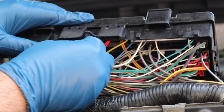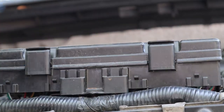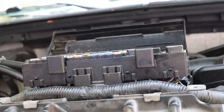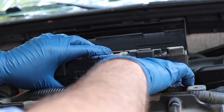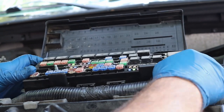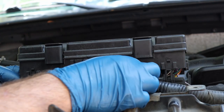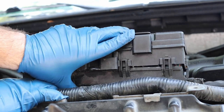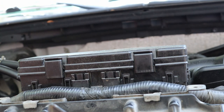Stick this right into there — it clicks right in. Tuck the wire in. Looking at the top of the fuse box now, we can see where we added that little spade. At this point you've got it handled — all you've got to do is put it back together the way it came off, which is pretty simple. Make sure all of your wires are in and you don't want to hurt any wires. Line it back up — I had a wire try to come through, so take your time and make sure none of that happens. Snaps in. Check your back side and make sure all that's going in good.